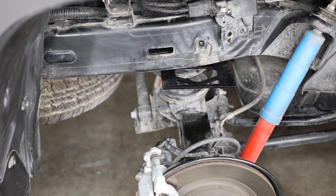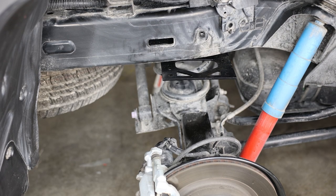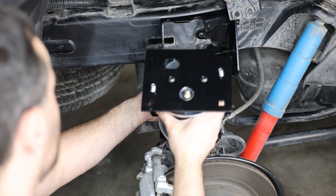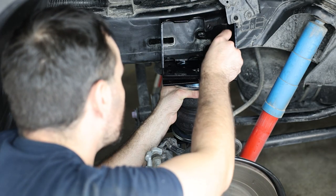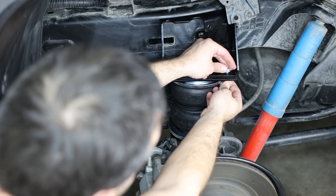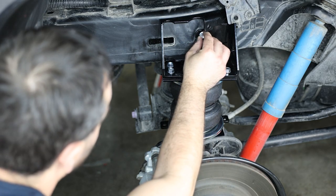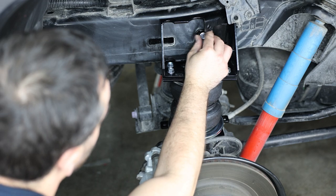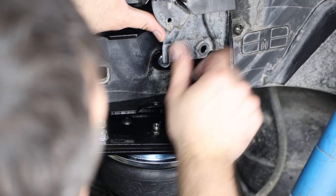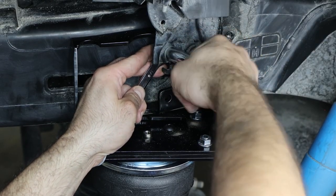To install the air spring assemblies, replace jack stands on the frame and drop the rear diff and axle all the way down. Place the upper brace onto the bracket, slide the air spring into place, add two serrated nuts to the short carriage bolts and finger tighten, then add the remaining carriage bolts and nuts and torque to 16 foot-pounds. Add the flanged M8 bolt through the upper brace into the frame and torque to 18 foot-pounds. On the passenger side, reattach the module using the removed OEM bolts and the provided M8 washer and lock nut.